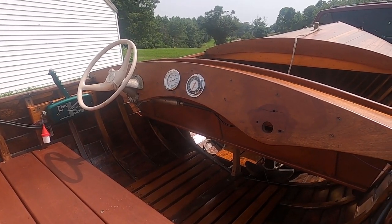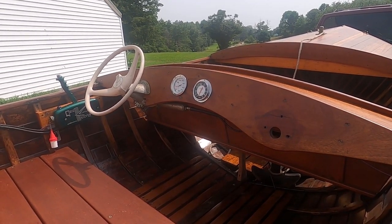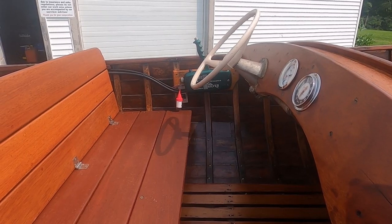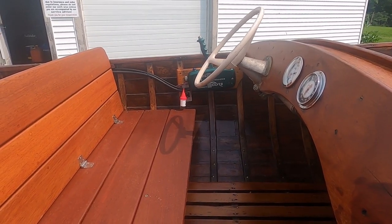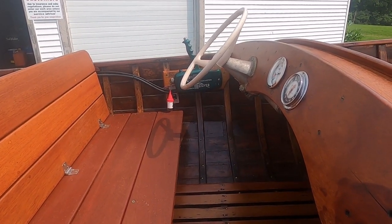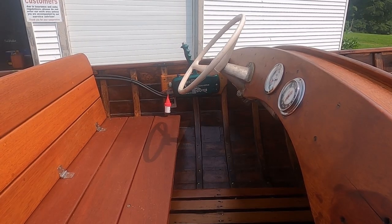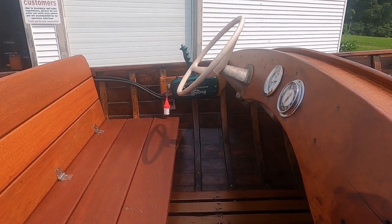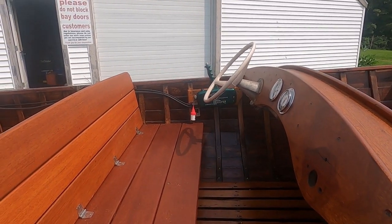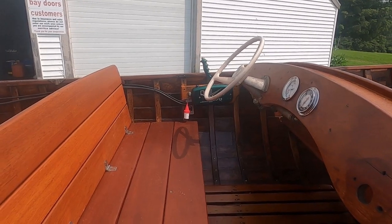The engine comes out of the water — no drag, riding way back. It goes good but I had hoped to see 40. The engine runs well. I put a shut-off switch on it and had a little trouble: with the key off it cut the ignition fine, but when the engine was running the alternator was putting juice in and it wouldn't shut off. I had to run the rectifier directly to the solenoid, and that fixed it.